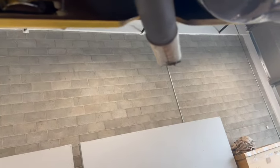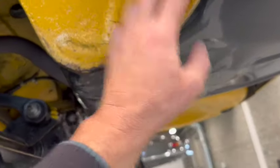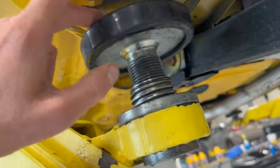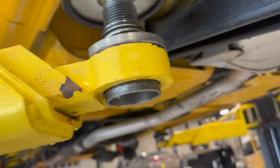The outside, this trailing edge of the body, is very susceptible to rust. And there's no soft metal or any indication of any rust at all in this whole area, okay? And then in the driver's side rear arch, again, we see the original undercoating, and we see solid metal all around, and the jacking point looking original, and certainly solid, okay?